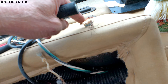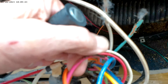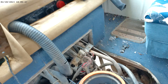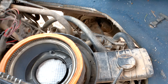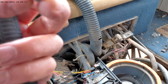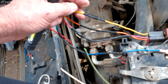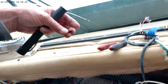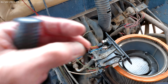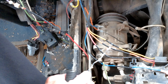I still gotta splice this to my wiper motor. I repaired these two wires right here and I will have to take that up and disconnect it. You know, quick connectors - the way I do mine is I crimp one in, take the torch and heat the plastic part up, and remove the plastic. Take this stuff off of there, heat it up until it gets soft and you can pull it off.